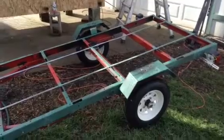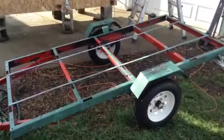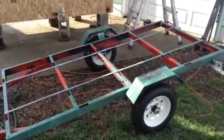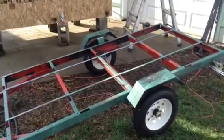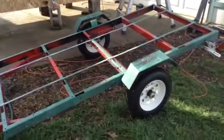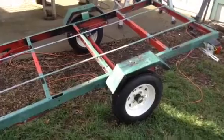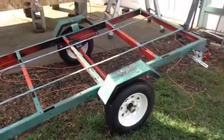The axles that the Chinese manufacturers at the Guangzhou trailer factory produce — which Harbor Freight and a few other companies import — this is what they call their heavy-duty trailer. This is their super-duty one, the one they call 1750-pound capacity. That's not really a metric translation; what it is is about 250 pounds of trailer on a one-ton axle. These are DOT US-rated, US parts-compatible axle kits included with these trailers.